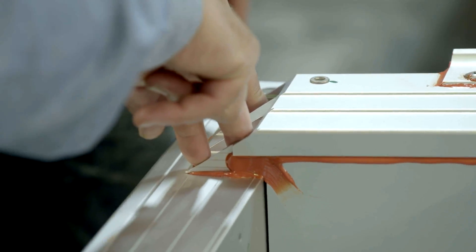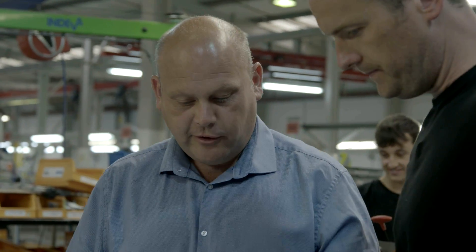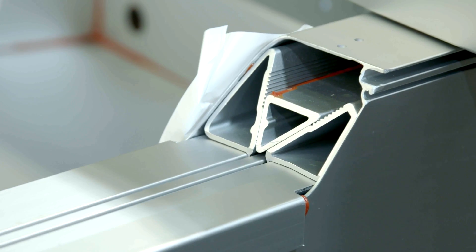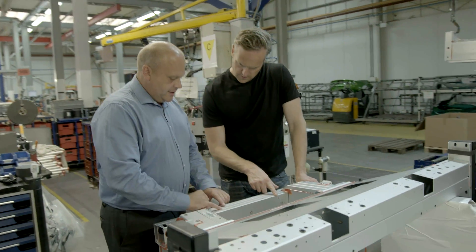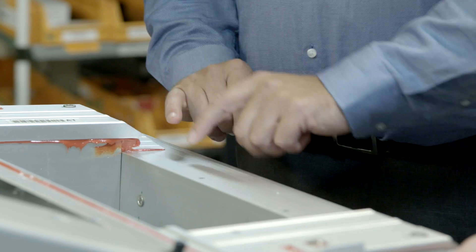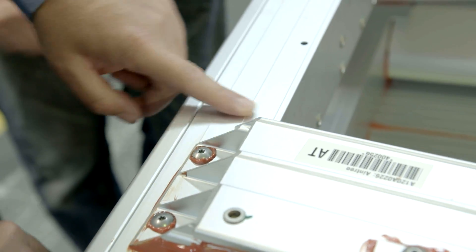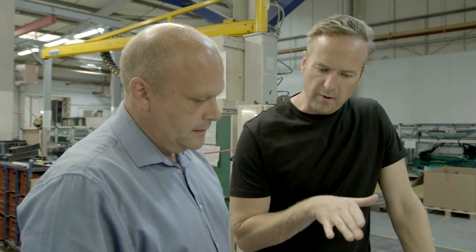The rivets are also a mechanical location while the glue is drying. The resin — is it as good or better than welding? Stronger across the surface area. Under here you've got nearly a 50mm strip by 100mm long. We control these gaps using the ridges you can see, which allow a consistent adhesive layer. If it were perfectly flat you might not get enough glue in certain locations, so these bond-control gaps prevent the two surfaces from sandwiching and squeezing all the adhesive out of the joint, guaranteeing a certain amount of adhesive in there.